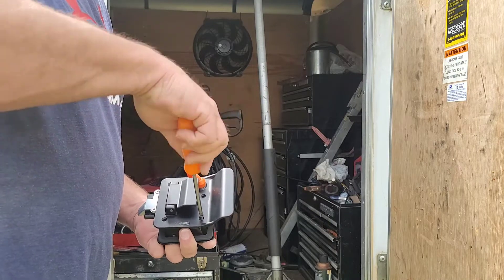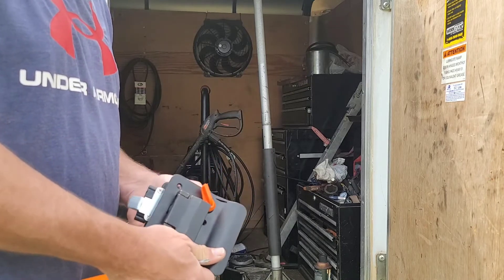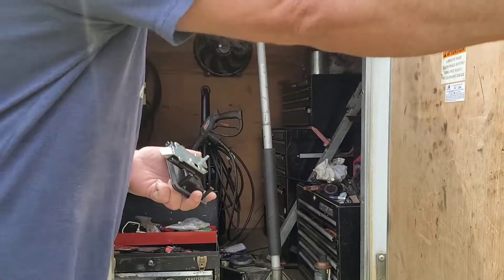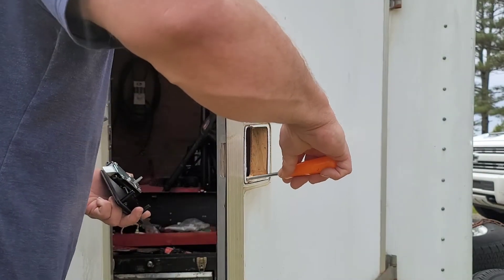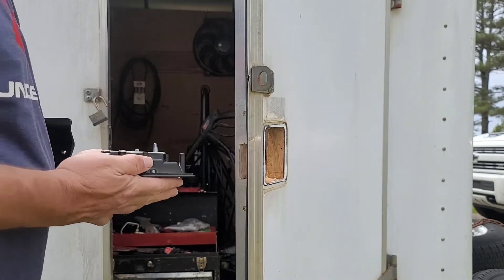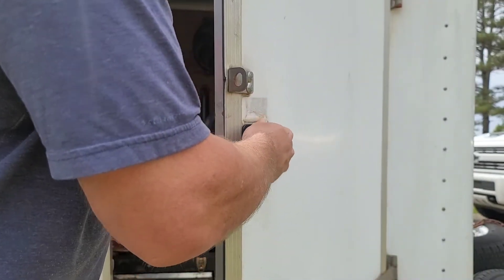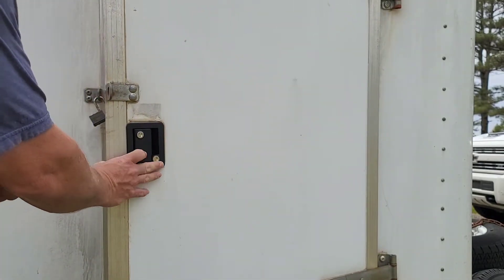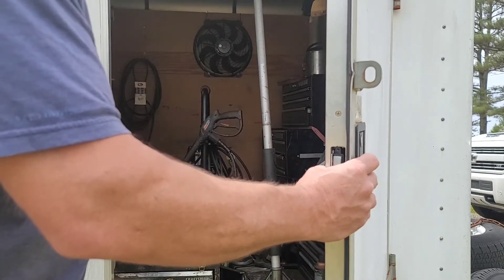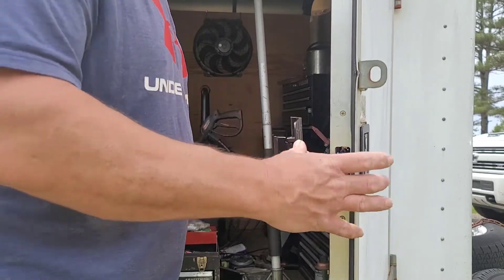When I was looking on Amazon, I really wasn't sure if it would fit or if it was what I was looking for. I really wasn't very sure about anything because I've never done this before. That should pull right off there — and it does. You just separate it like that. Now scrape what's left of the old gasket out of here, and this should go right around and slide right in there like that. Perfect fit. There are some adjustments I'm going to need to do as far as up and down, but I want to go ahead and get the latch on so it's not slipping and sliding around and taking a chance on falling out.